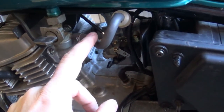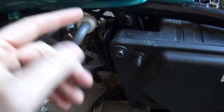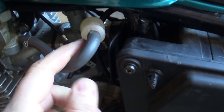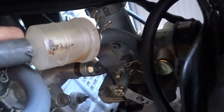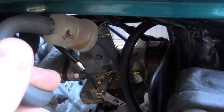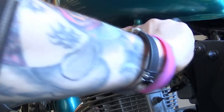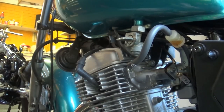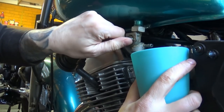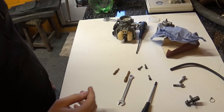This setup is still using the new carb with an extra fuel filter — a lot of you said it's too long, yes it's temporary. However the shorter original setup still wasn't working properly. I set up a clear secondary fuel filter to see whether I'm getting any crap coming from the main filter in the tank, and indeed I do — so that's probably one of the reasons the bike isn't running properly. I checked the petcock and petrol flow is really good, no issues there, but I will inspect and double check it.